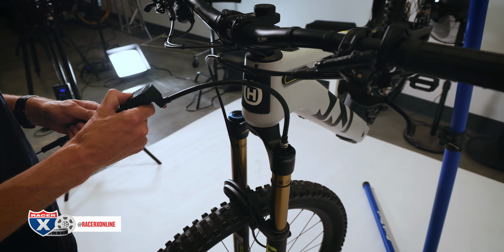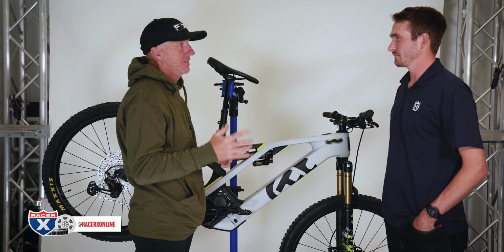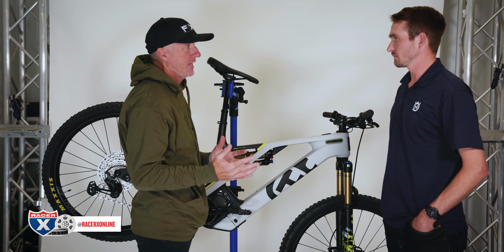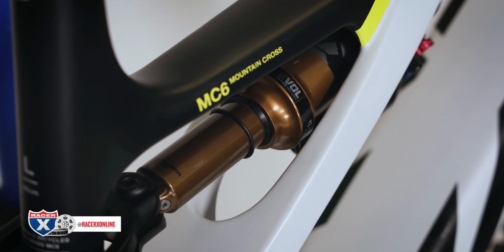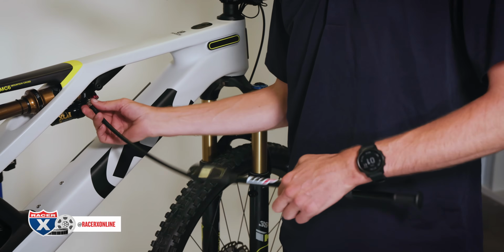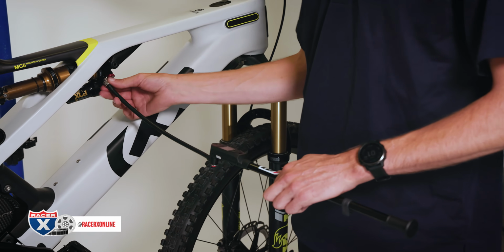All right, so rear shock, again, like I said, I get my new bike. I think I might sit on it in the dealership and they go, okay, there's shocks that have auto sag. I'm familiar with that. So explain this unit for us. So this is a standard Fox Float rear shock. The best thing you can do with a baseline, just based off of testing we've done in-house with our e-bikes, I like to tell people to start with 20 PSI over your rider weight.